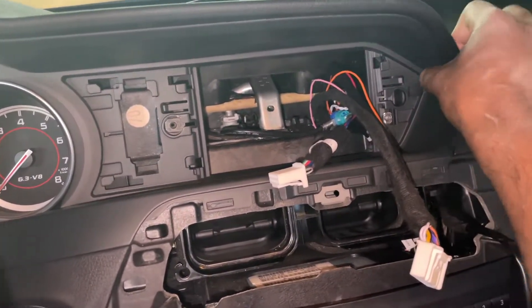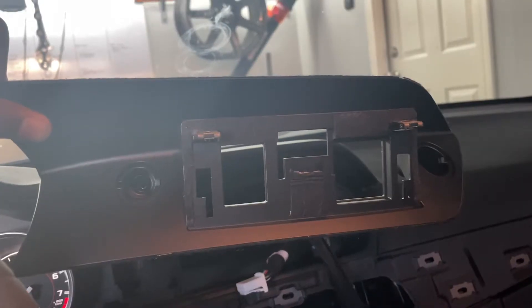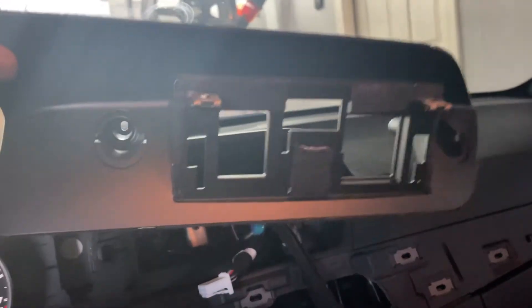We are almost there. I made a mistake earlier — you want to put the AC controls in before you put the command unit back in. If you do like I did, just loosen the bolts a little bit, pull the unit out a little bit, then slide that guy in, plug all the connectors in, and you should be good to go. I also put the top trim pieces — the backing plate, the bezels for the gauge cluster, then the bottom trim piece and the top one. Remember: the top one goes first because there are some latches at the very end which this is going to slide over.